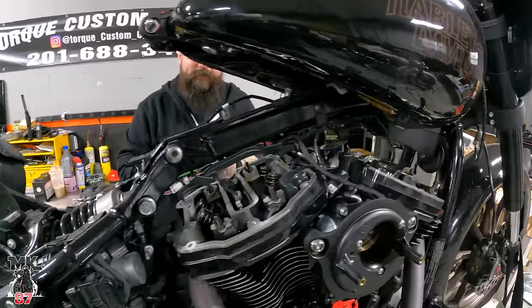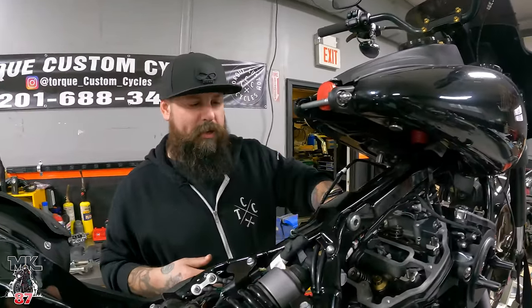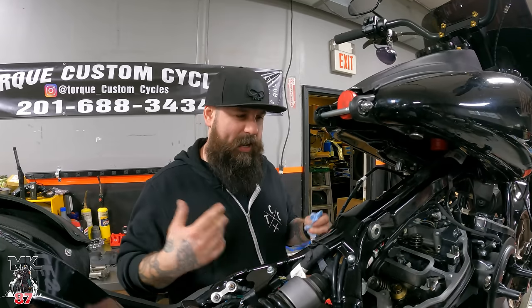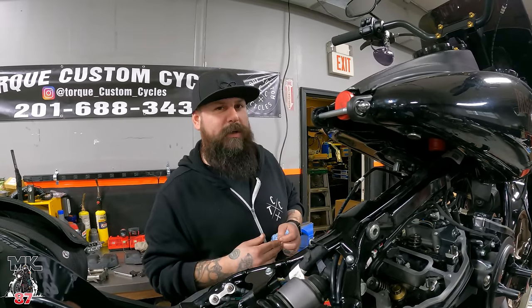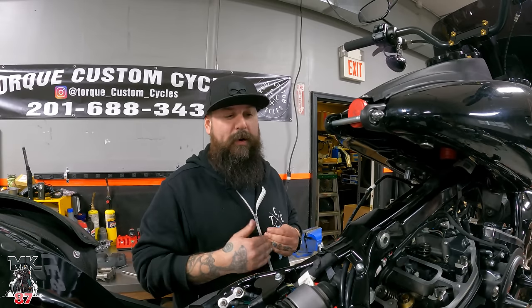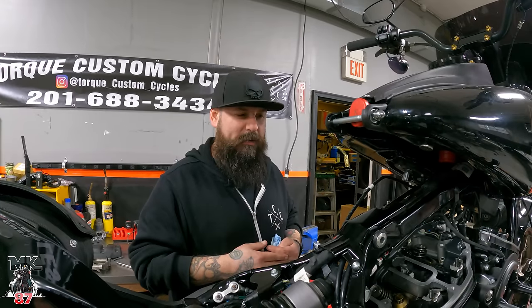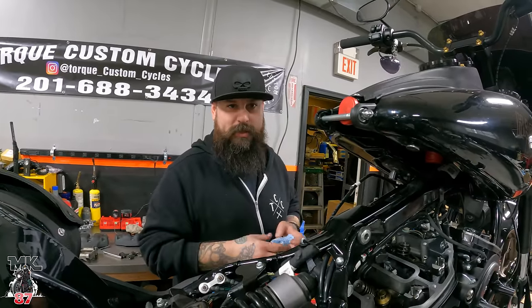He was telling me that the rocker arms have too much play. I haven't personally heard of a lot of information revolving around rocker arms, other than checking that one valve doesn't hang lower than the other, and that the valve springs aren't the greatest in these particular bikes. What I'm looking for is that you still have a consistent noise in this engine that will not go away. We've already done your cam kit and oil pump, and then I took it apart and redid it again just to make sure there was absolutely nothing wrong in there. I found a torn seal behind the oil pump, which is not great, but it's also not causing the noise. We moved our way up through the push rods and still can't find anything, and now we're at the rocker arms. The rocker arm end play is what I'm looking at, and that's where we don't have a lot of information, at least out on the internet.